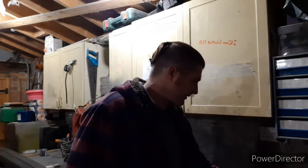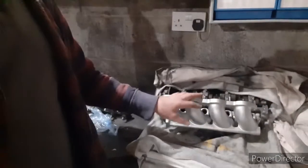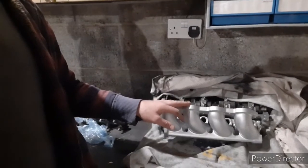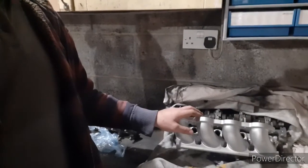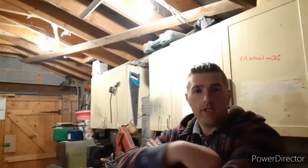I've got the lower part of the inlet manifold on the head. I was going to buy gaskets for it but I would have had to cut them to match the ports anyway. I remembered I had a pack of gasket paper in the cab, so I made some gaskets last night. It's all on there nice and tight, sealed up and ready to go. I'm just going to double-check I'm happy with the cleanliness of the block surface and the head surface, then I'll get the cylinder head bolted on.